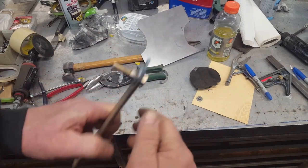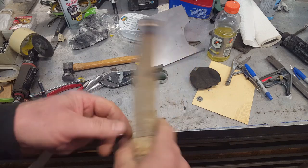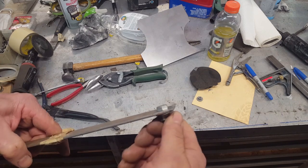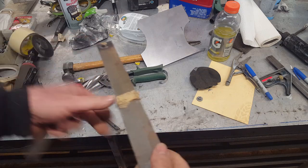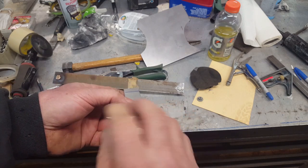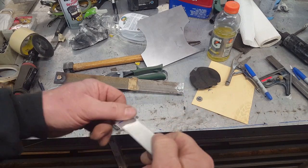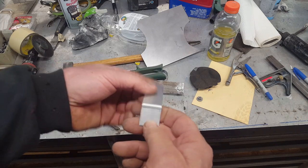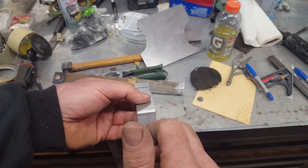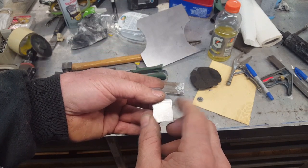I might want to keep as much material as possible, depending on which way I want to bend it or how much leverage I need to bend it. Then what will happen is the hole and the capture nut are already there, so that when I have my bracket, I can line it up with an existing tab that I've already welded into position, and I can run the bolt in the exact location, mark it, trim my last little bit off as far as my length is, and tune it in until it's fitting exactly. But I'm back engineering from the bracket that's already on the piece that's going to be bolted to the car, and this is the extension that'll bolt from the car to that point.